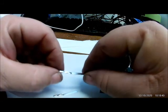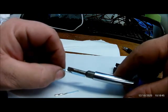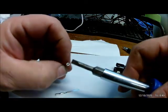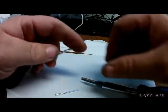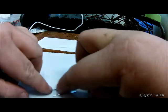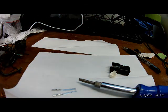So I don't see a failure in here except for this. This little push knob right here pushes down on the center there, and that's what's giving it the tension to hold to the springs. So what I did on all of them to fix it is I'm pushing this center part right there down. So you get a small screwdriver. In this case I'm using a Leatherman.